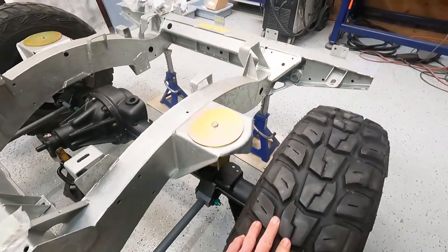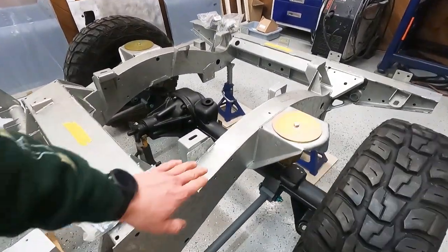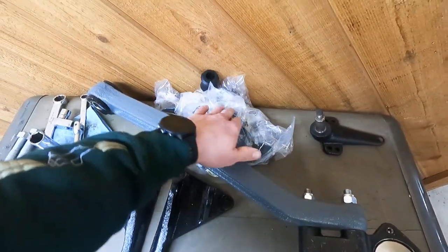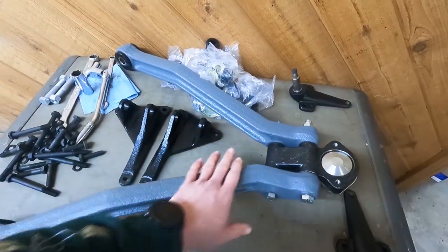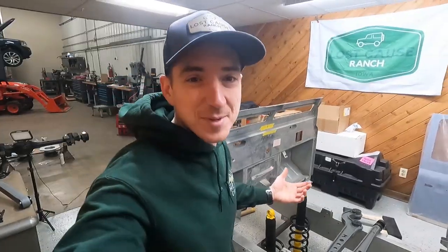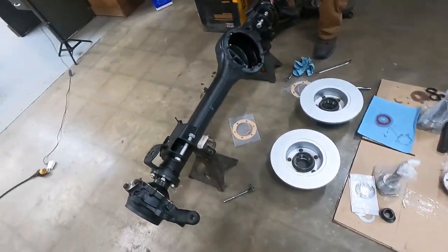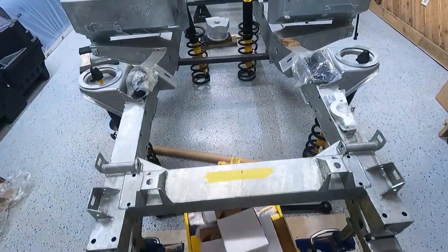It'll have all new fresh matching hardware for the final assembly. So we got the rear lower arms in, the axle is roughly where it needs to be. Now we're gonna get our brackets all mounted up — they're sitting right here, we got some hardware, bushings for the shocks, shock mounts. Get all these guys bolted up, get this upper arm in, then we can start tossing some springs in and it'll be sitting on its own weight. Ted's over here assembling the front axle, getting the new swivel balls put on, so shortly we'll have a front axle under this guy as well.